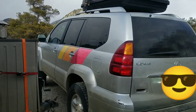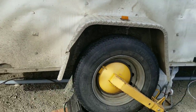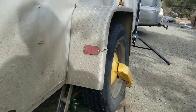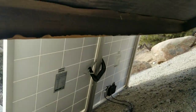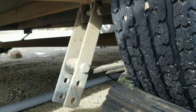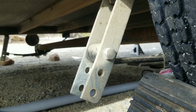My beautiful 2006 GX 470 tows this thing all over the country. The only maintenance I've had to do on this trailer for transportation has been replacing the leaf springs. I actually broke the leaf springs when I was off-roading one time on a trail I probably shouldn't have been on with this trailer. You can see I really scraped up the steel on the back, but these things are built like tanks — you can really handle anything. I put a new, slightly longer leaf spring on here and I've got those extendable shackles so I can lift it another three inches by moving the bolt down.